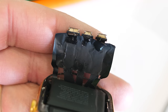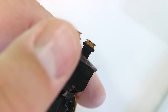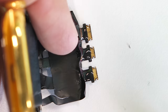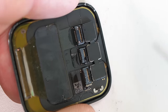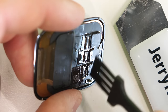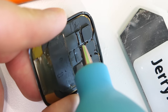Taking out the other electronics like the motherboard and heart rate sensors gets super complicated because everything is so miniaturized. If I peel back the plastic over the screen ribbons, I can expose a little T-shape arm below the gold contacts, and use these little arms to gently push the connector up into its slot. The ribbon connectors are a bit dirty, so I'm going to clean these off as best I can with the alcohol, as well as the latches on the screen itself. I could replace the screen at this point — the whole display costs $200 — but I kind of like the story that the gold-looking ring around the edge comes with after being underwater for 9 months.